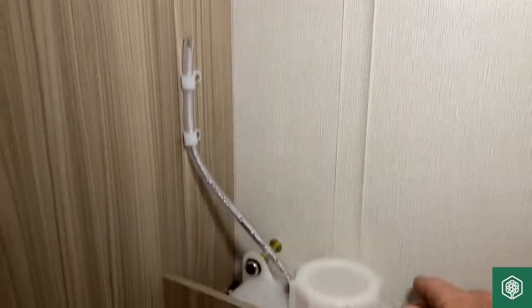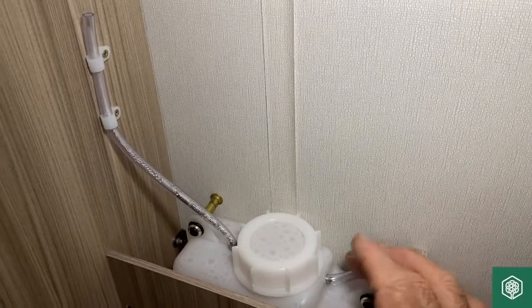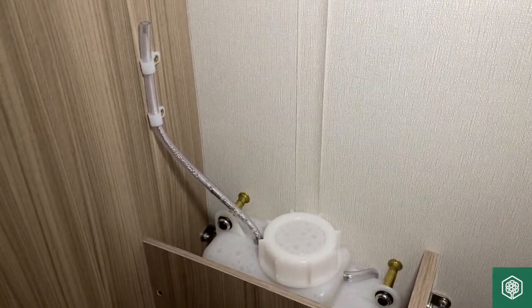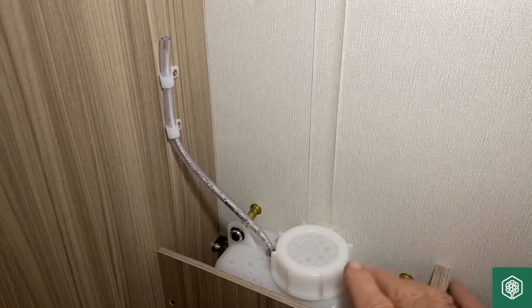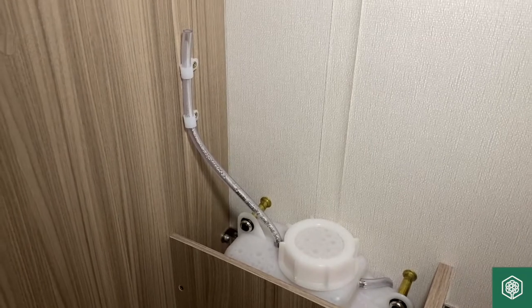It allows for expansion of that fluid. There's another pipe just on the head of the tank — just where my finger is now — and that is the drain: if this system was filled too high, the antifreeze would dispense down through onto the ground, and you're just wasting fluid.